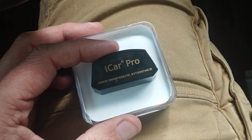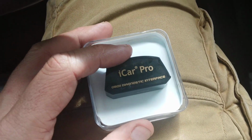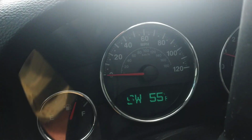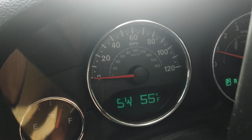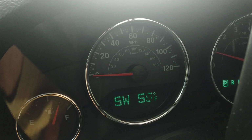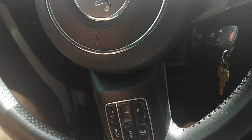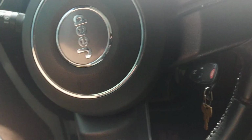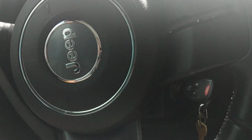So to adjust the shift points for the transmission for fuel economy, it is more proper to tell the vehicle what you're using. Also, that change in circumference around the wheel itself, putting 4 inches onto something that's 31 inches, you're adding about 10%. So your speedometer would be off by an enormous amount, about 10%. So if you're going 60 on your readout with 35s and you haven't told the computer which tires you have, then it will be about 6 to 7 miles an hour off, and 10% obviously as it goes through the band of all the miles per hour.